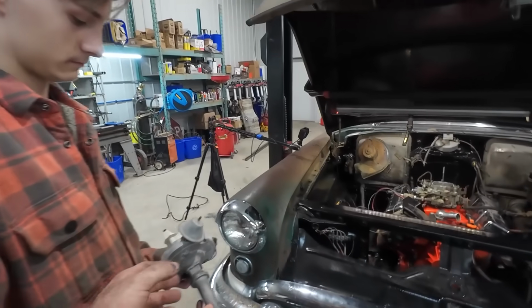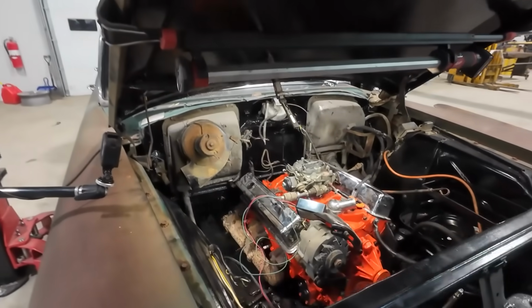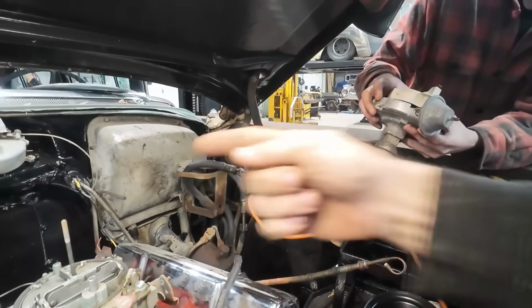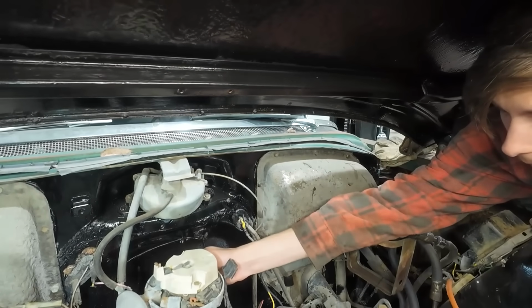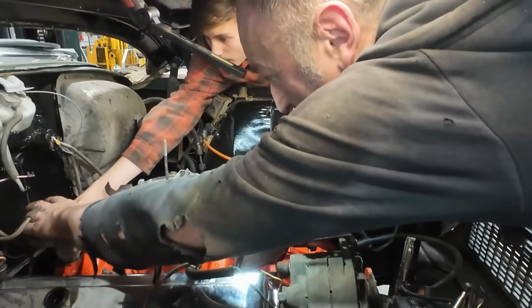So the way this is going to go, and it might be a little tricky, but what we're trying to do is point this at the spark plug that you took out. That's the idea. So this goes down the hole. Where's that gasket? We're going to have to get you a new one. This one wasn't in the greatest of shape, and it'll leak like a sieve if we don't put that in there. Anyways, with any luck, you'll get this first try. If not, there's a whole lot of suckiness that goes with this. Try to drop that down, and it should go kind of that way in. You want this thing pointing off the side. Turn this. I want this thing to be pointed at number one. And it's gotta go all the way down.